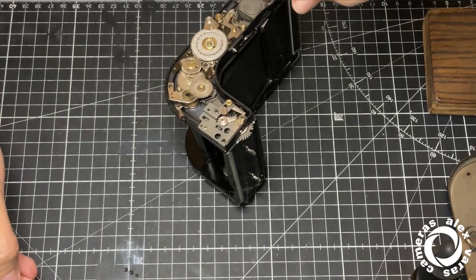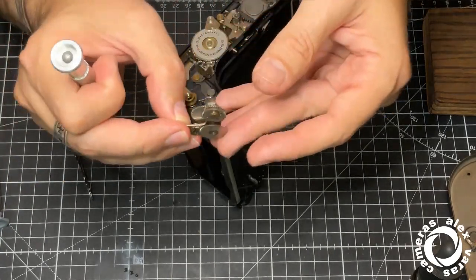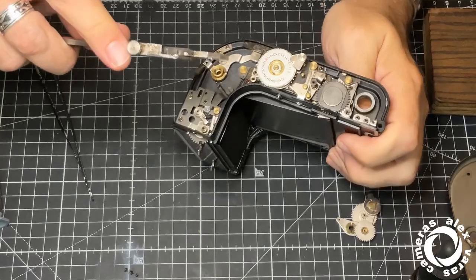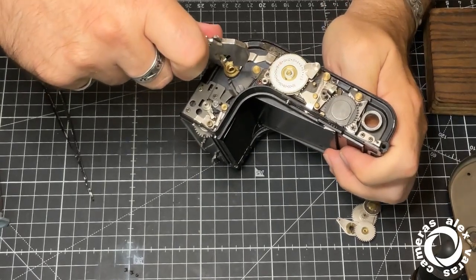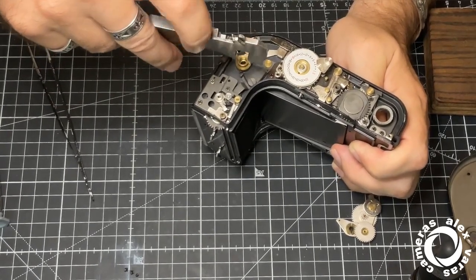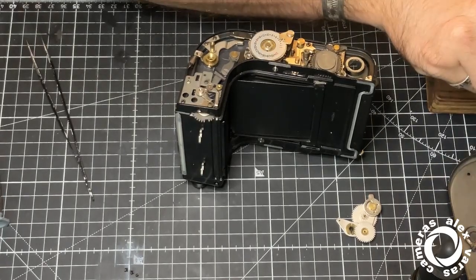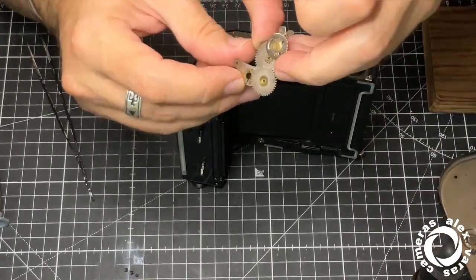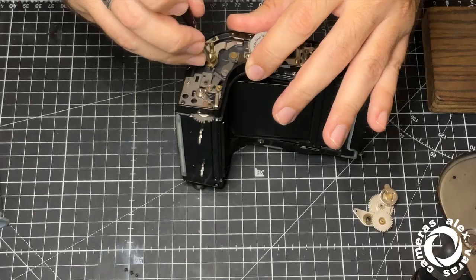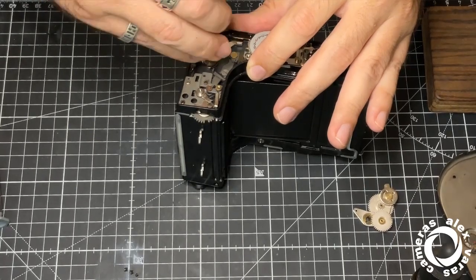If I remove this first, it will be easier. This screw is sealed with some soft rubber — not very hard to remove. This is one piece, goes to the cleaner like this. The second part is also quite tough to get out. It is important to have the correct tools, because even with the correct tool I left a mark here. If you don't have the correct tools, you might spoil the screw — and then it would be impossible to take out.